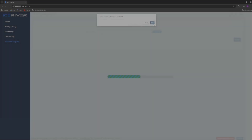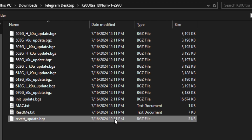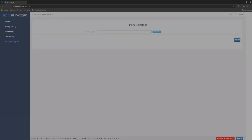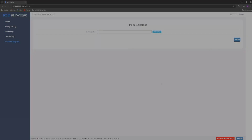Operation succeeded — and that's it. If you want to revert, what you're going to do is go to file, upload the revert file, hit update. When it goes to that screen where it said press okay or cancel, hit cancel. Exit out of the message and then do the restore factory settings — that will wipe the firmware off of it. I have now done it three times. As long as you do it in that order: install the file that says revert update, hit update, cancel out once it says succeeded, cancel again when it says restart, and hit restore factory settings and hit okay. You will be fine. You will not break it. It will go back to factory settings.